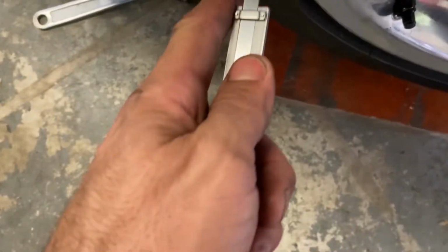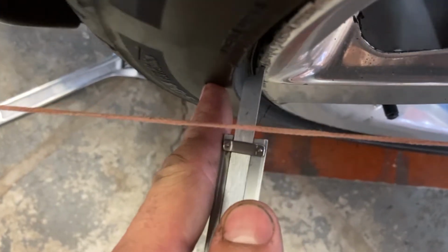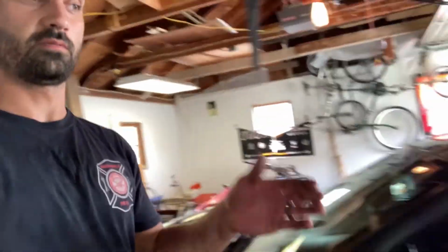And it's the same, okay? So that's how you check. All right, guys, so you're gonna go back and forth. Check your measurements over and over. If you bump your string, bump your chair, whatever you're using for the corner, you're gonna have to readjust it.